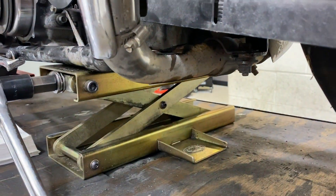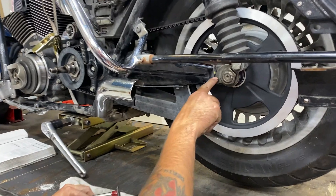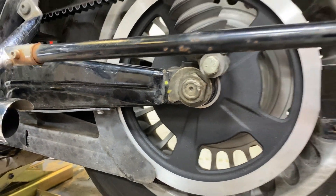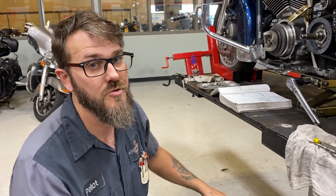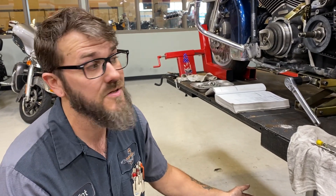That's all the belt deflection I need — it's nice and tight compared to what it was when I took this thing off. That's where you're supposed to be with a new belt. You can also see where the marks were with the old belt and where it is now, so there's still a lot of room for adjustment. I mentioned earlier that over a couple hundred thousand miles these belts can stretch, but most of us aren't going to put that many miles on a motorcycle. I've seen maybe two in my whole career where a belt actually had to be replaced.